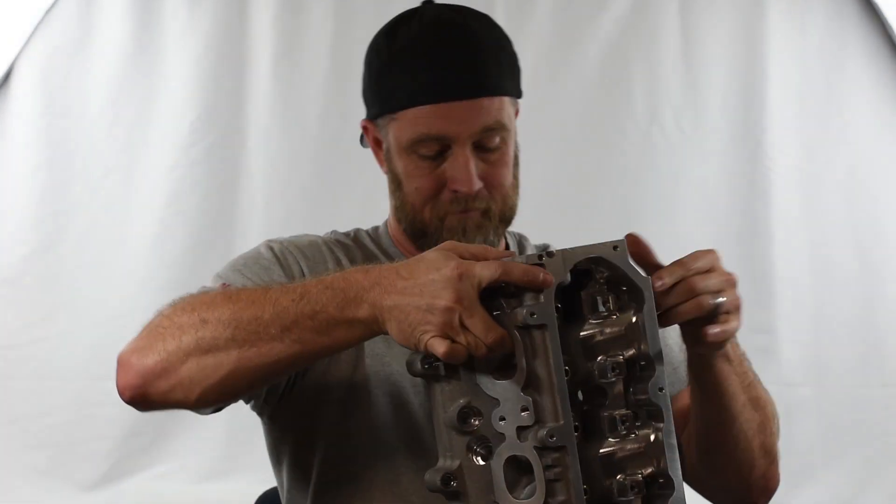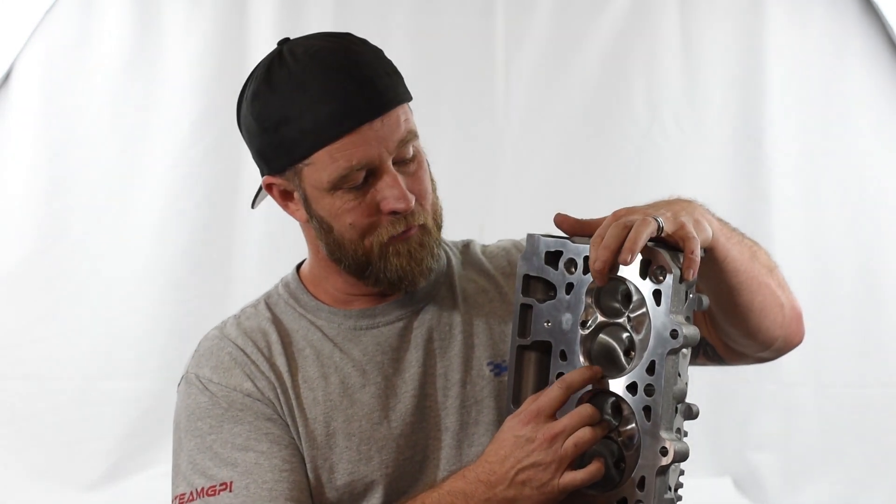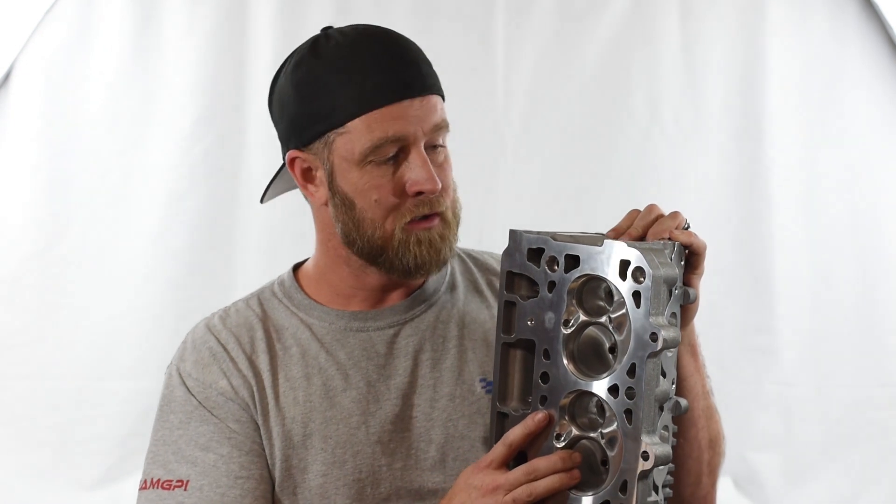Last example would be our CID LT head. This is one of two chambers we offer — this is our LT4 style chamber, the larger chamber volume at about 63 CCs. This chamber is only 4.060" to 4.062" diameter, so you don't really have anything to worry about with this head as far as gasket diameter, because most of your LT gaskets are going to be 4.099" to 4.100" bore gaskets. Just want to go over that — it's something you guys need to consider when putting your combination together: not only your engine bore, but look at your chamber diameter and make sure your gasket isn't too small for your chamber.